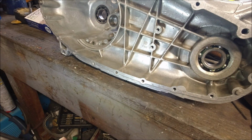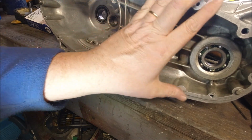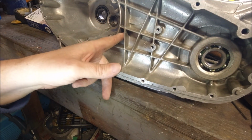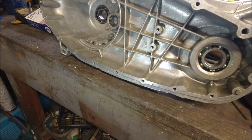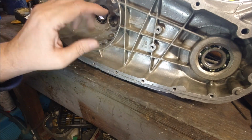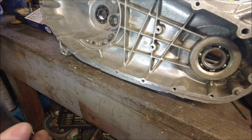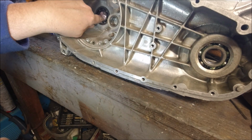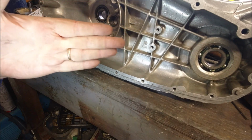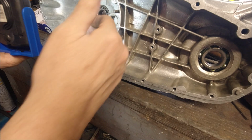You know, some people do, some people don't. I mean, it's as easy as putting a ruler across that's got a flat edge on it and measuring with verniers or whatever, tape measure, whatever, and just lining them up. Some people use dial gauges and rotate them around. The problem with that is, as we had on my LI, if the rear hub bearing's gone, you can get like an induced wobble, and that will feed through to the chain and the clutch moving in and out.